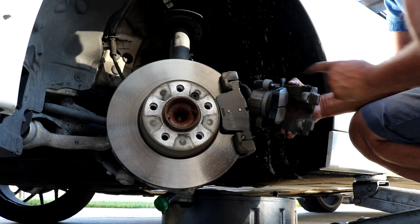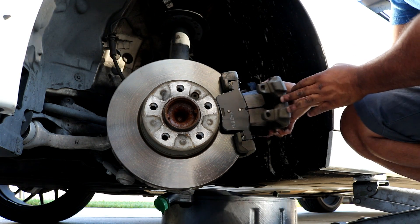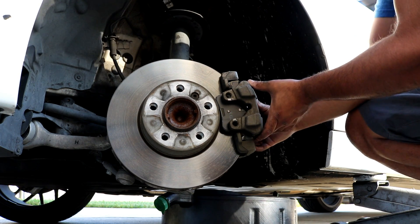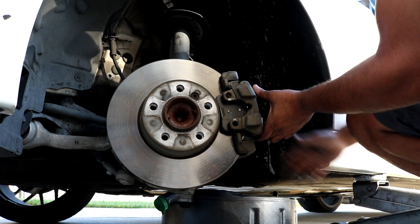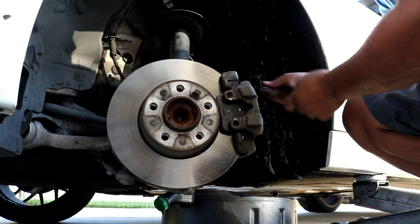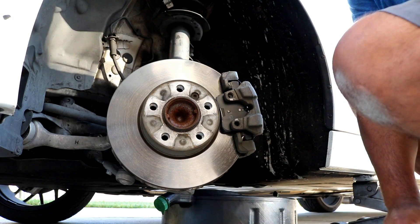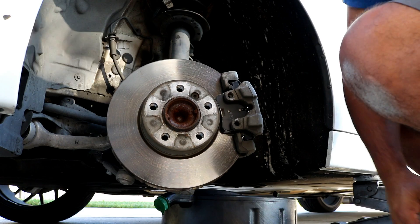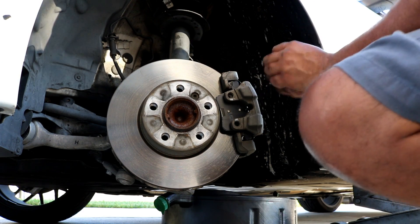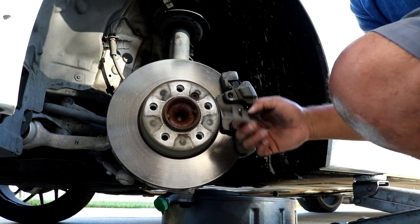You may find that you need to push the caliper bolts out so that you can have room to slide the caliper back into place. Then right when you've got them back into place, go ahead and re-tighten up the 8 millimeter socket bolts holding the caliper on. Make sure you reinstall the plastic caps that cover the bolts in the back.